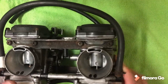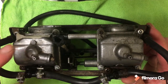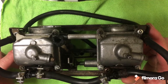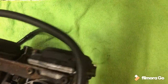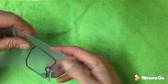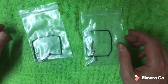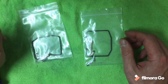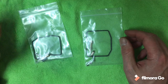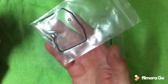From the last video, most of the leaking seems to be coming out of the left side rather than the right-hand side. So a bit of a strip down and replace bits and pieces. I'm also going to have a look at the floats and the float heights, but I think it's just the seal. I'm going to do a little bit more than that just in case, while it's off. I've got the carb repair kits times two — although one was leaking and the other seemed okay, there's no point just doing one.